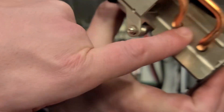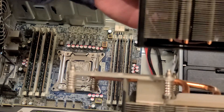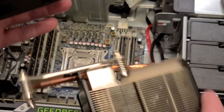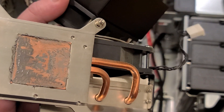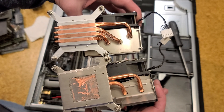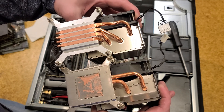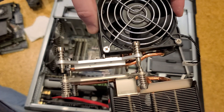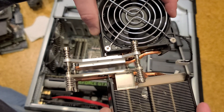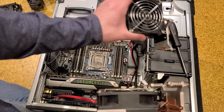You can see where the fins here are actually kind of cut out. So we're going to be upgrading to the new one. There's the old one — the new one has a bigger block, thicker stack of heat sinks. We can see that they indeed are the same offset, so that's how you know it'll work. The bolt pattern is also the same. It's fortunate that they just use the same pattern in the Z640, so you can at least upgrade this upper heat sink.